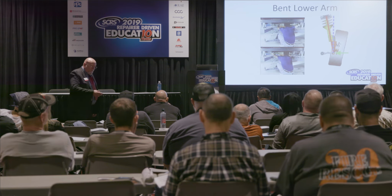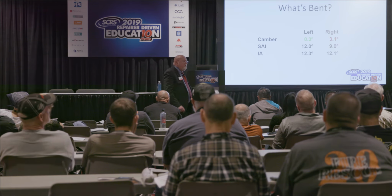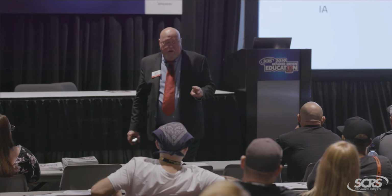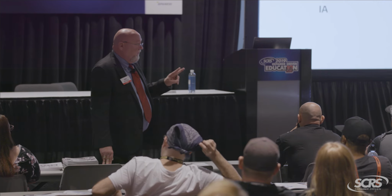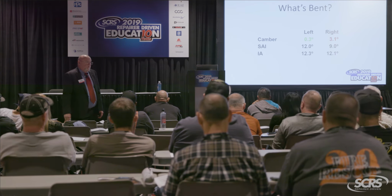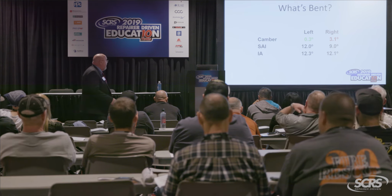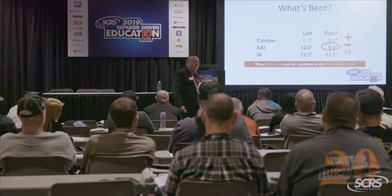Okay? Now, if we back up to these numbers, there's a clue in these numbers. You want to compare your good SAI side with the bad SAI side. Now, there are 3 rules that I teach in my 2-day class that I do for Hunter for diagnostics. And I'm going to give you 2 of them here. All right? When you compare those good numbers with the bad numbers, if the bad number is low, you're going to look low for the damage. Rule number 2 is if the SAI number on the bad side is high, look high. What do we have in this case? It was low. So in this case here, should have led you right straight to the lower control arm.